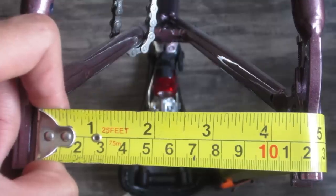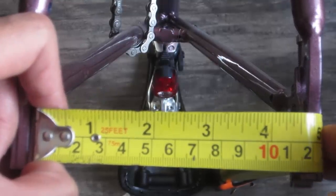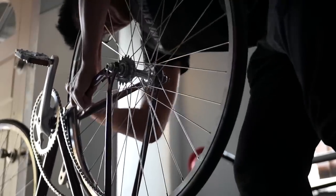It's a new day. I just finished measuring the really tight rear spacing on the 4130 Core Line. The standard for rear spacing is 120 millimeters, but this bike has 115 millimeter rear spacing — that's half a centimeter smaller than it should be. Of course this frame set isn't the most expensive thing in the world, but it retails for $190, and at $190 it should at least meet the standards that all fixed gears and single speeds are held to.